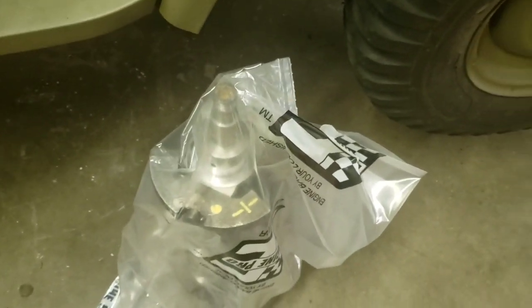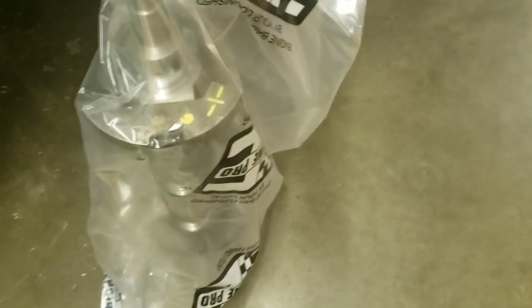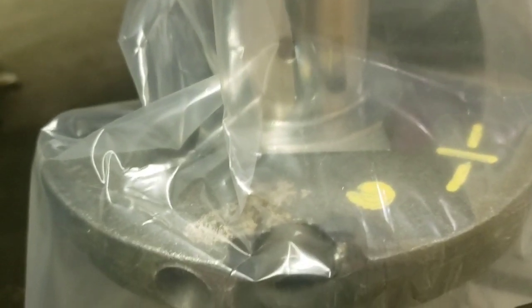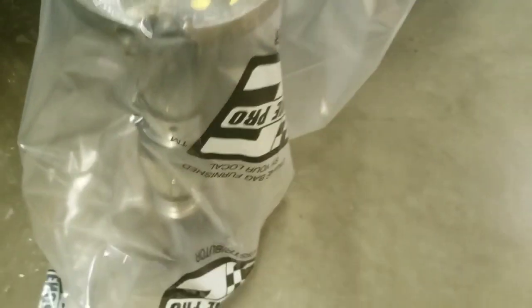Something that's often forgotten is here's our freshly machined crankshaft. As you can see, it's a CJ crankshaft with the big bolted on and then welded fly weights. But I will rifle brush all the oil passages I can get to in the crank and clean that out. This thing's been on a machine that has a giant sanding belt to sand all the journals and polish them. And that dust gets in the air and goes down in those little holes. And it's very abrasive. Ruins your bearings. So those get cleaned in the same process.